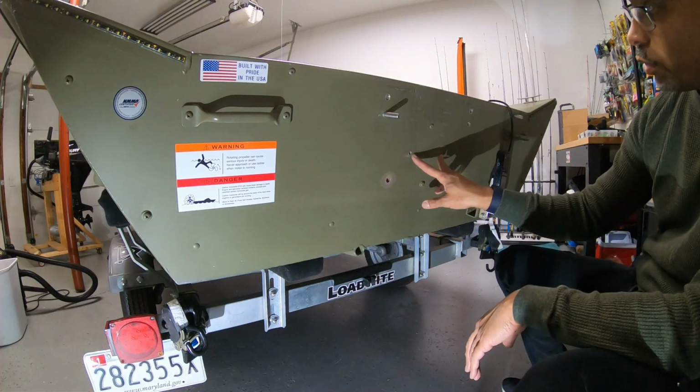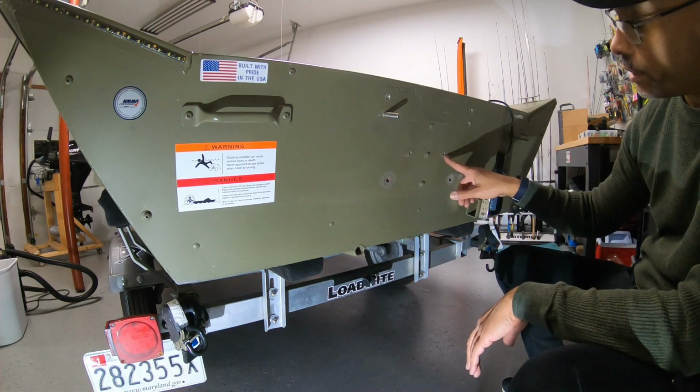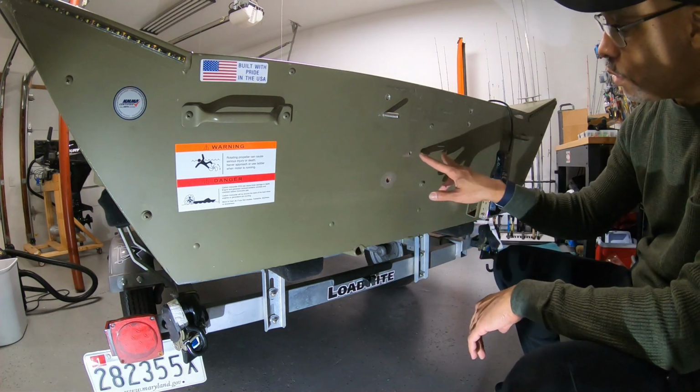And I've got the 2 holes that I had in here from securing the motor to the actual transom of the boat. I'm gonna stick some bolts through here with 5200 as well. So I'll be sanding down these 2. So that's just how I'm gonna go about sealing up these 2 holes right here.